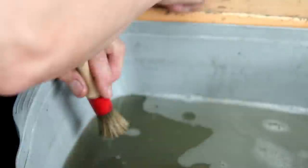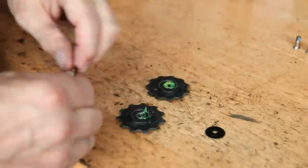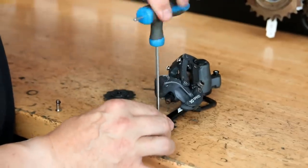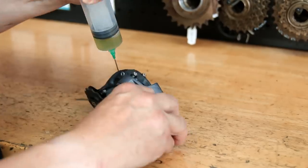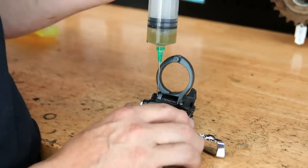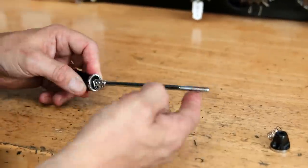We clean off the jockey wheels — we don't put those through the ultrasonic cleaner because they have their own bearings and we don't want to flush out that bearing oil and grease. We clean those up on the bench, a little bit of lubricant on the back of those plates either side of the bearing to stop them corroding or sticking in the future. Then we lubricate the derailleur, because these parts were very dry — obviously they'd sat for years, everything was a little bit dry with some surface rust, which doesn't do any harm.